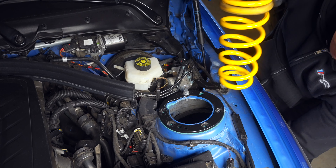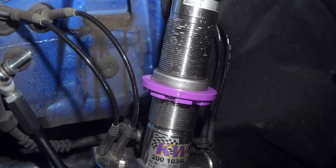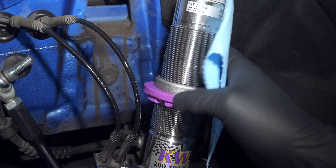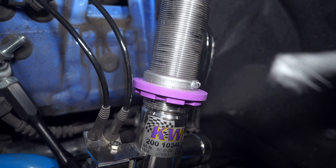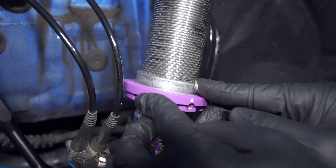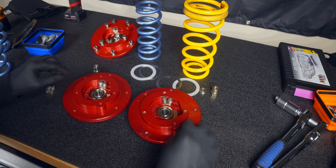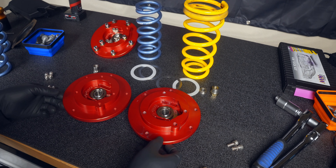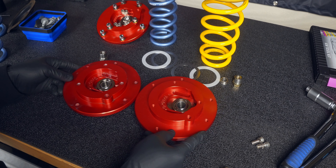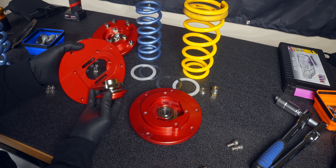This gasket is in good enough condition to be reused, but I had another one ready to go so I decided to replace it. While we're here, let's also clean the threads, and since the new spring's inner diameter is 60mm and the spring perch is 61.5mm, let's apply a thin layer of anti-seize on the collar. With Vorschlag's later model camber plates, you only need to order the 60mm spring perch, as the top plate is compatible with both perch designs. Looking at them side by side, the mounting location is the same on both models, providing up to 32mm of sliding adjustment.